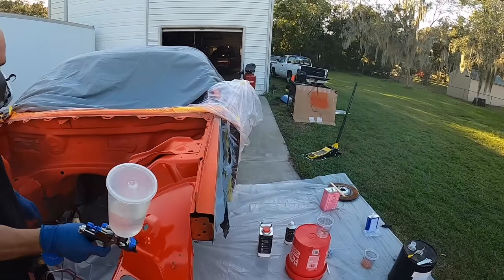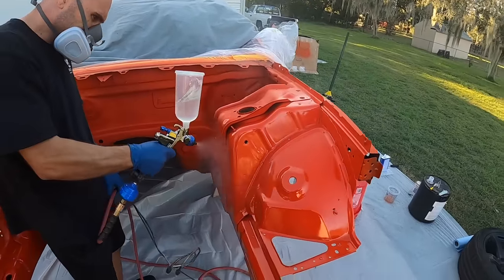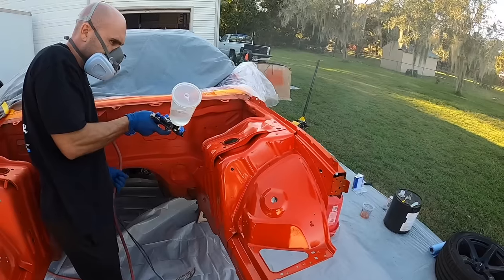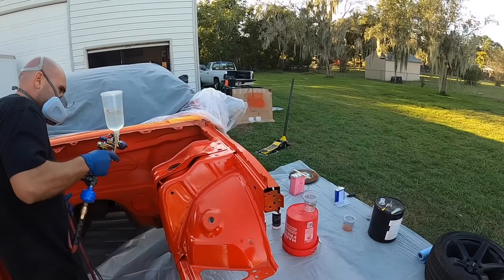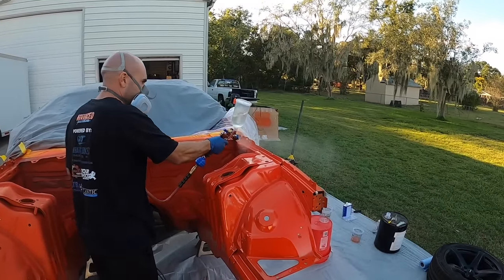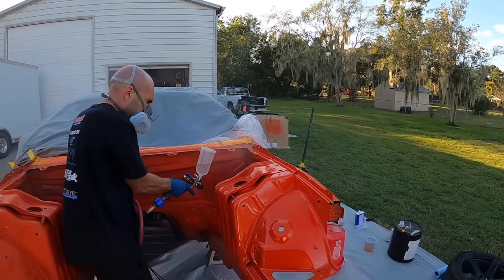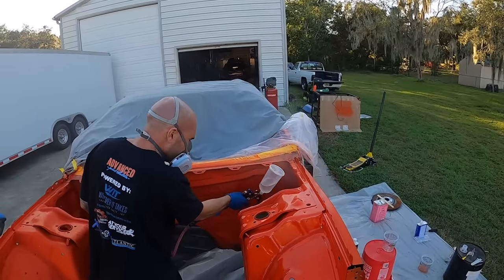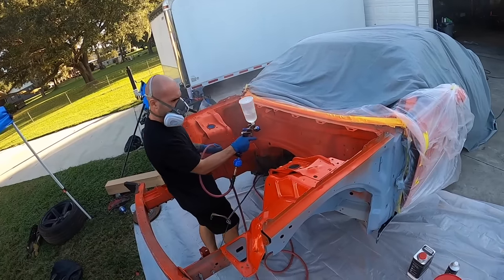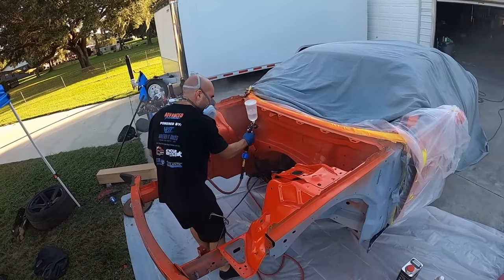Remember, it's just a base. Just the first coat, so I don't want to be doing no dry coat. No sweeps, even. How the sweep? Well, you stay the same distance. Come on, suck it up, Buttercup. Full lengths, John, full lengths. Start at the right, go all the way to the left. There you go, full length. 50% overlaps, there you go.